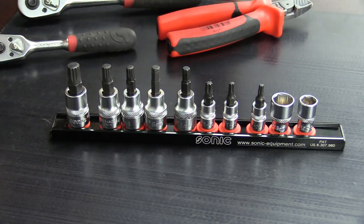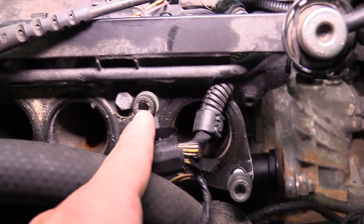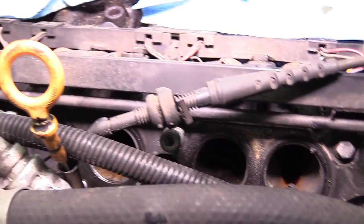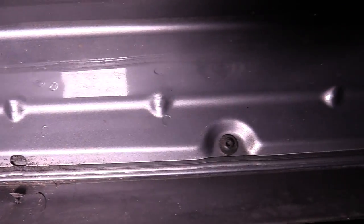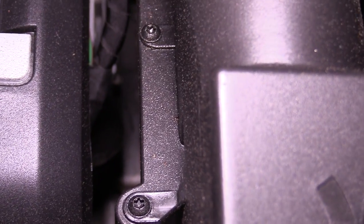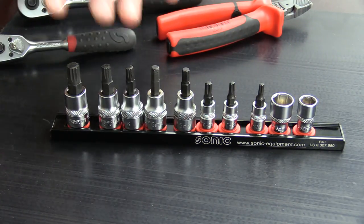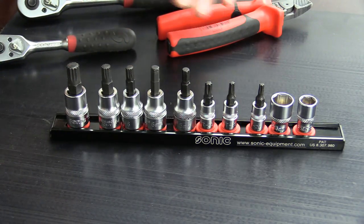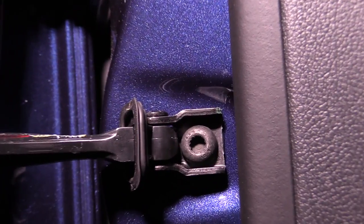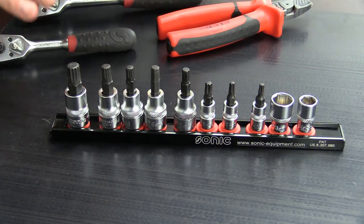The reason I picked these sockets is these are some of the most common tools that you're going to need on a Volkswagen or Audi. 10mm and 13mm are all over the place, both inside the car and outside the car. T20 is typically an inside-the-vehicle fastener. T25 and T30 can be anywhere in the car. Number 5 and 6 Allen — these four sockets may actually be the most common fasteners in the entire vehicle. The triple squares are a little less common, but you can't just run to any store and buy these, and I wanted to include something so that if you needed to do repairs, you had just about everything you're going to need.